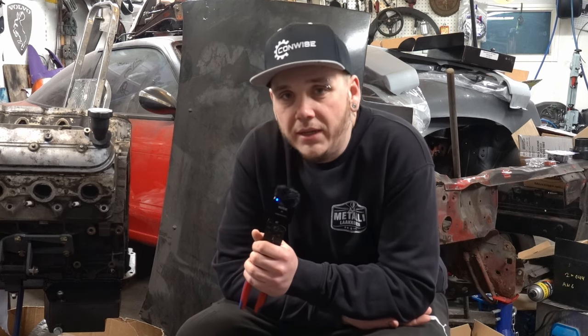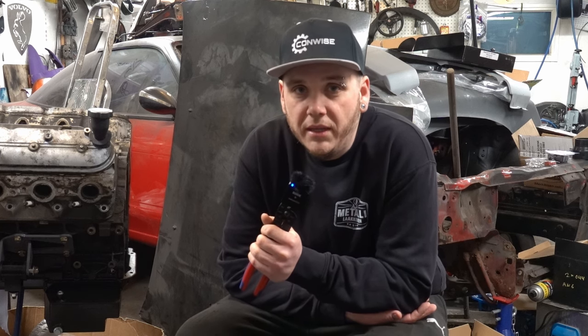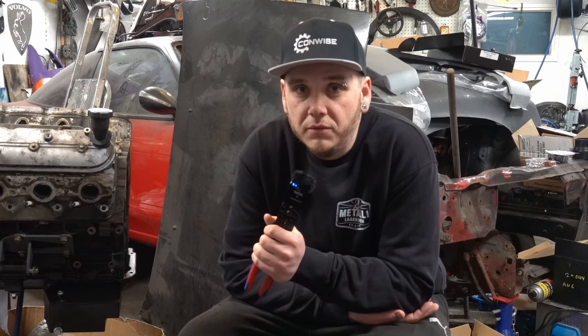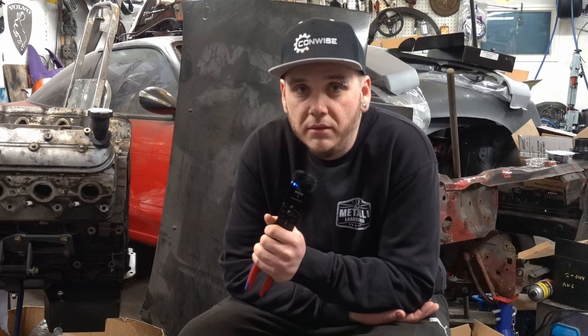So that's how you install an angle kit for E46. I don't know how much the angle really increased because we did not do the alignment yet, but maybe 5 degrees might be pretty close. We also installed the coilovers that came with the car, but those were useless. They were all dead. So we are going to use the stock suspension in front, at least now because of our budget.